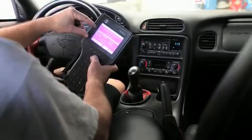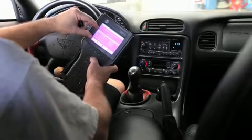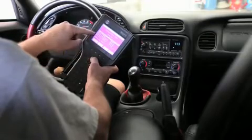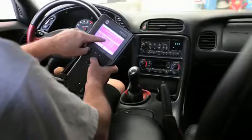This screen that it lands you on is somewhat incomplete, and I want to scroll up two line items so that we can include the column lock state. It says: ignition off locked, column feedback inactive, column lock unlock A, column lock unlock B.